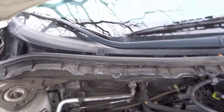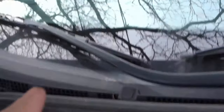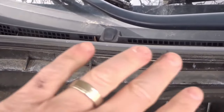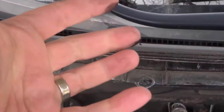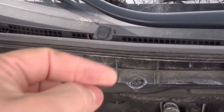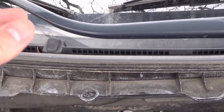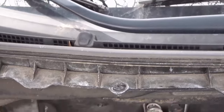In this case, we have the nozzle right over there — that's what it looks like. And like I said, if it's under the hood, you can just pop the hood and it's going to be underneath the hood. But in this case, it's over there. So what I would have to do is remove all of this plastic and this fascia over here, which would give me access to the actual hoses behind there — the windshield washer fluid hoses that connect to the nozzles. There's the other nozzle over there. At that point, I could remove the nozzle and then clean the nozzle directly.